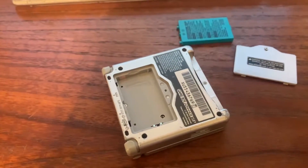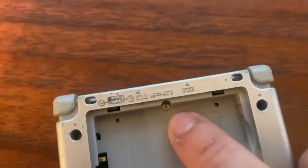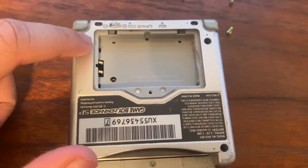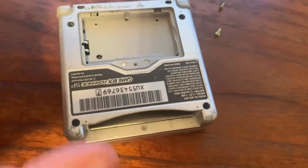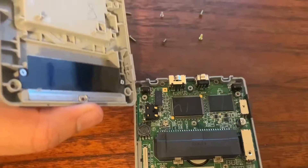Go to the side — after that we got a screw underneath there which is a tri-point screw. Take that out. You also need to remove the screws on this side and this one too. Once you've done that, lift the back part out. From the back piece, you want to salvage what's right in there — this little square nut — keep that safe.